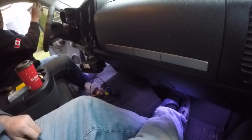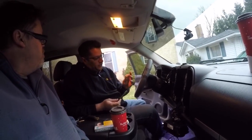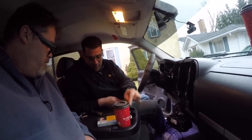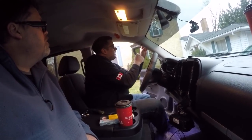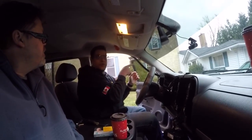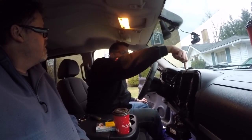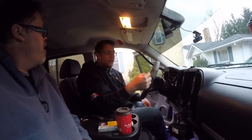How do you like my floor lights that I put in? Those are pretty decent — those aren't factory. The good thing about taking off these A trim panels too is that when you get the Bluetooth mic in here, you just run it down the A pillar and then behind the head unit, instead of having to go down and then around and up again.